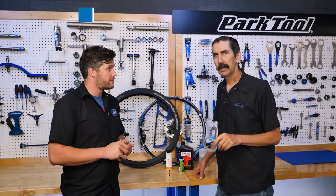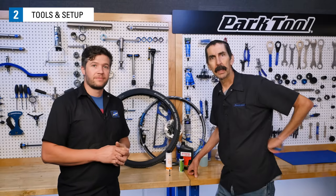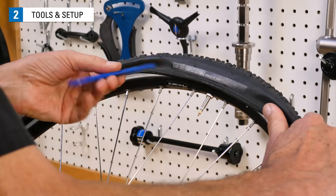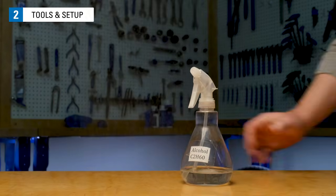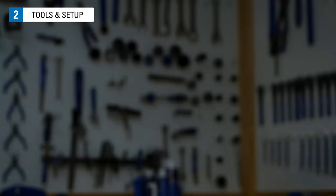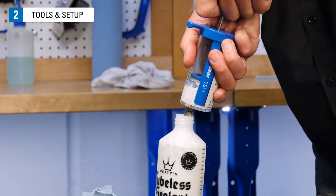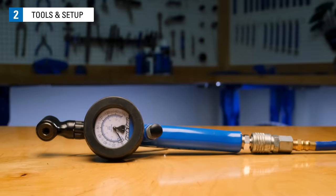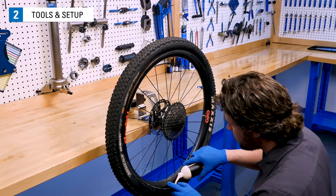Let's have a more detailed look at the supplies, parts, components, and things you're going to need to set this up correctly. For setting up tubeless tires, you'll need tire levers, soapy water, isopropyl alcohol, a pick set like the Upick from Park Tool, lint-free cloth, scissors, a VC1 valve core tool, a syringe for injecting sealant like the Park Tool TSI-1, a pump or compressor, and a wheel holder like the WH-1 can make everything just a little bit easier.